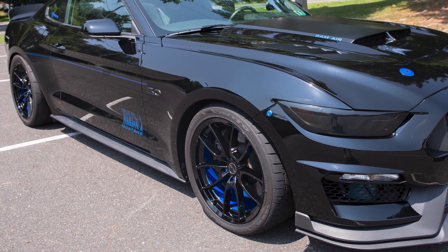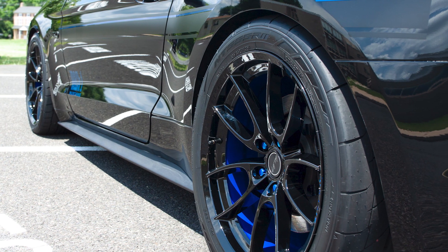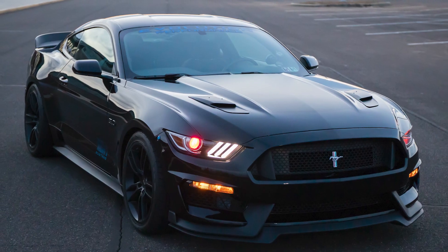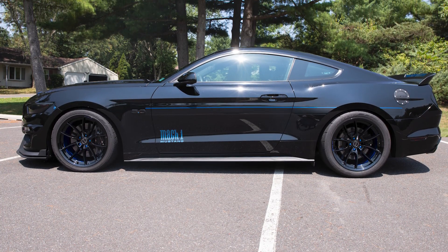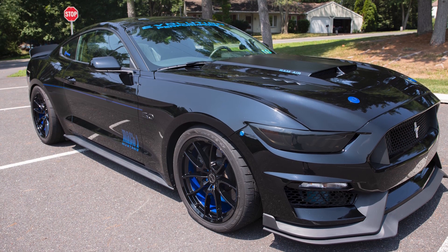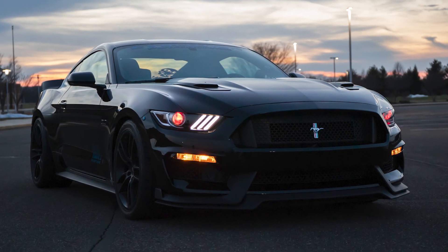Speaking of functional parts, you have the Pedders Sport Rider spring and shock kit on there. A lot of guys might not know the Pedders name — Eibach and all that stuff kind of comes to mind as the biggies — but I'm a big fan of what those guys do. It's been really good. For the price point, I don't think you can beat it. You want to lower everything and do it right — not just cut your springs or add springs without shocks and struts. You get the lowering kit, the shocks, the springs, the struts all together and just throw it in the car. It was an afternoon to get done. They're huge in Australia where they originated, and they're slowly catching on in North America. Their coilovers are great too.